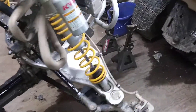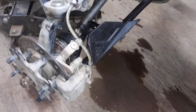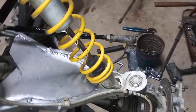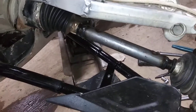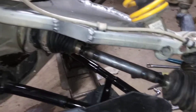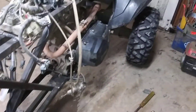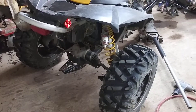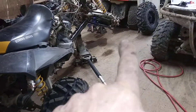The A-arms are all in place — everything's bolted down, nice and smooth. Same thing with the A-arms over here. I'm anxious to see how this visco lock works; I'm used to just having an open differential. The wheel spacers are on the back also — I put two-inch wheel spacers, actually it's 50mm in the back and 51mm in the front.